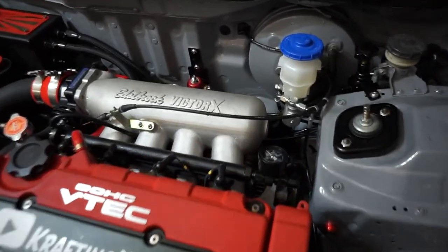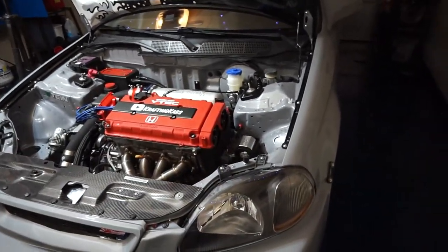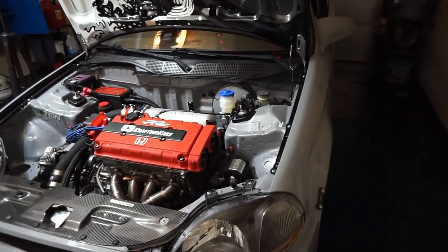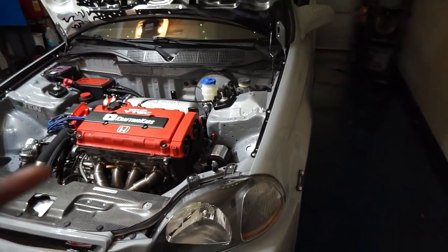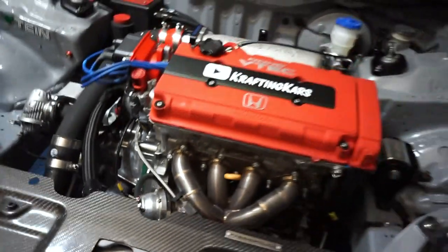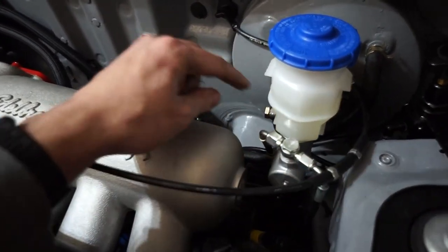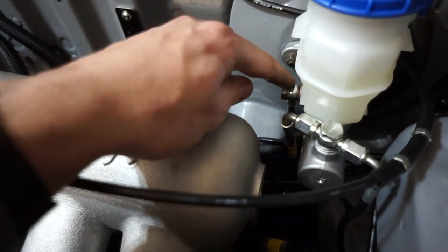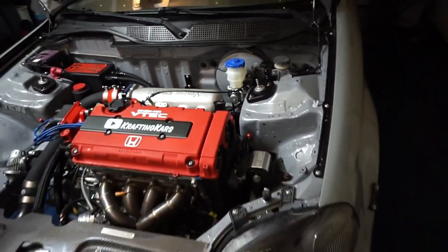Since we just connected the front and rear brake lines, you're going to want to go ahead and do a four-wheel bleed all the way around the car. I'd do that today but I just finished installing new brake lines front to back, so when I bleed these I'd like to get another person underneath the car checking for potential leaks. Also worth noting: if you're using a stock master cylinder with stock brake lines, your stock brake lines should screw right back into those ports no problem. But if you have banjo fittings like I do, I highly recommend you replace the crush washer — that'll help prevent potential leaks in the future.